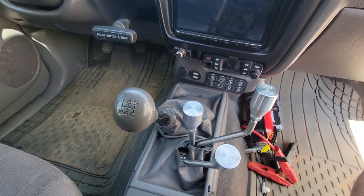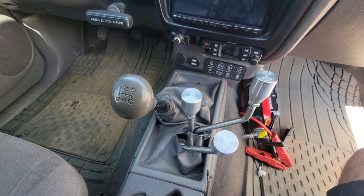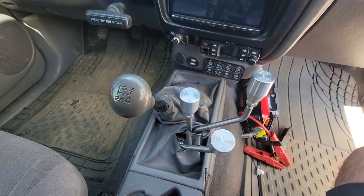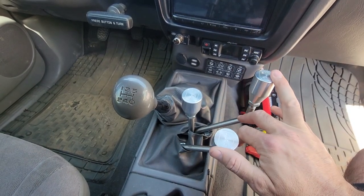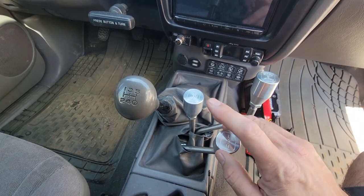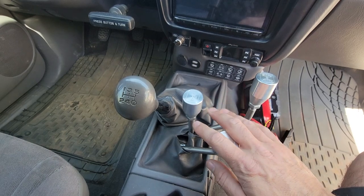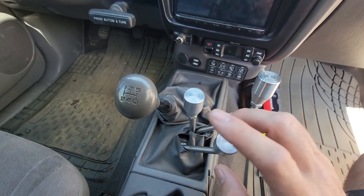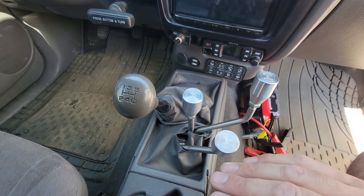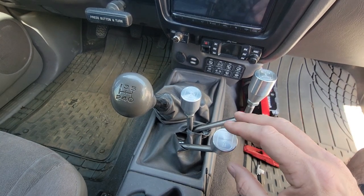I'm going to get you some footage of actually being out there and doing some stuff pretty quick. My next video that I'm going to edit is of us using the doubler in Sand Hollow. We went up a couple of things that this would not have gone up without the doubler. If I was just in low range four-wheel drive with the locker on, I would have been slipping the clutch a ton. I would have had to slam into things, where now I can just crawl right up to it and use the throttle when I need to.